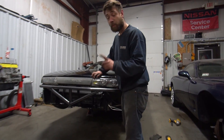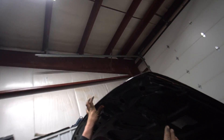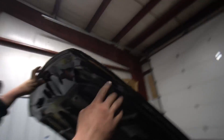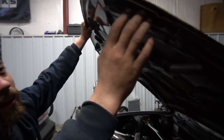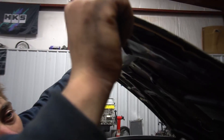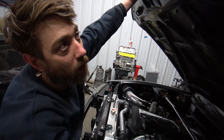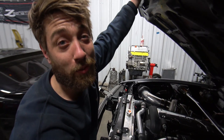You can tell how bad this hood was from the inside — it's still somewhat fixable, but it's like a tinder bitch: might look nice on the outside but whoosh inside. That's the baggage. We could still fix this later on — a little Bondo, a little hammer and dolly. To really fix it properly, we'd have to peel the hood skin back, get a relief hole going, push the metal back out, and re-seam seal it. But we ain't got time for that before the drift event. Let's mud this thing up and send her home.